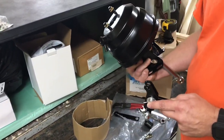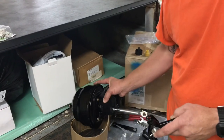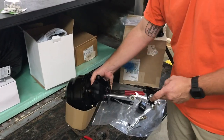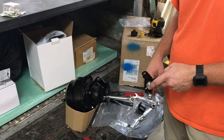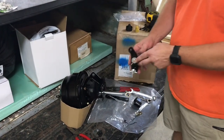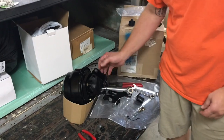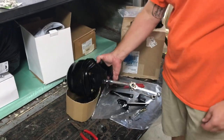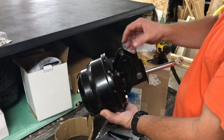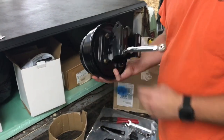What we were trying to figure out was how the linkage worked with the booster, and it kept being too long. There are no videos online of anybody doing this on an F100 of this year model. What we found out is the proper way to do this — you lose this whole linkage. All this comes off the bracket. When you mount it on your booster, the points are going to be up — you can see where it's scuffed a little where the linkage was.